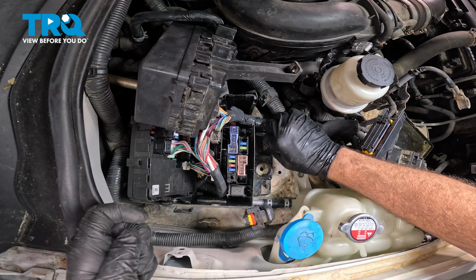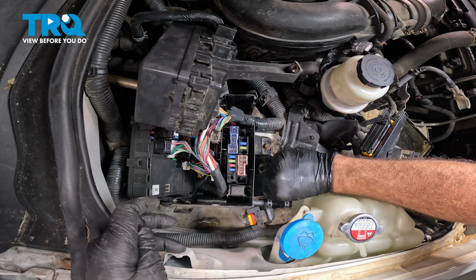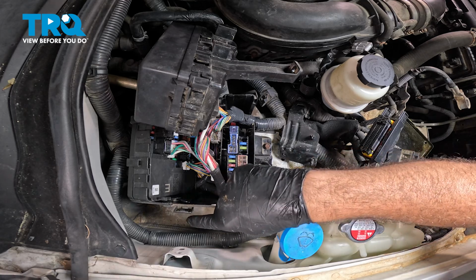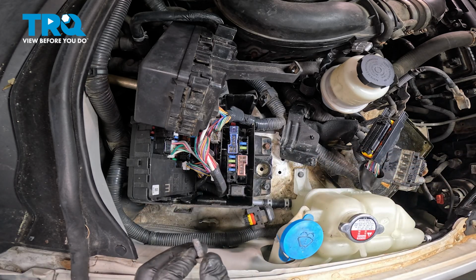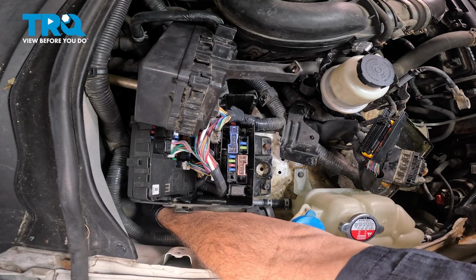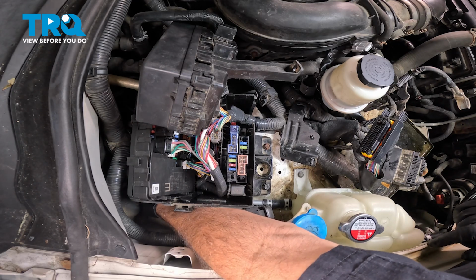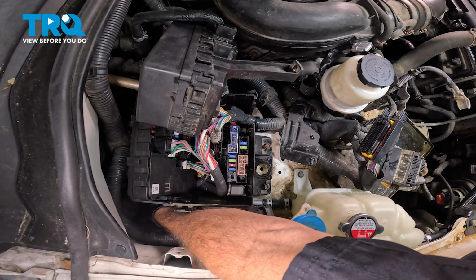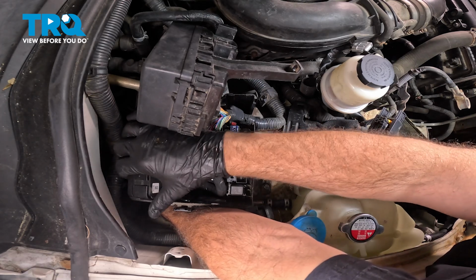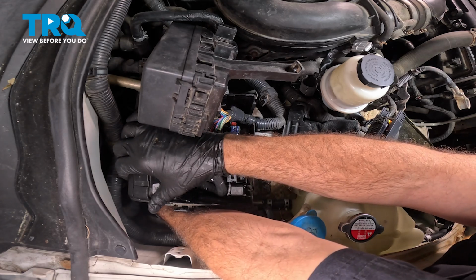I am going to get the 2 forward bolts started. That's going to help the box itself line up. So now I can take the 3rd bolt. I need to reach down around the back side here and get our 3rd bolt installed. You have to be a little bit of a contortionist to do this. It's tough because the whole thing is only by feel. You cannot see the hole there, and you can't see where the bolt's going. All right, so we'll go ahead, there we go.